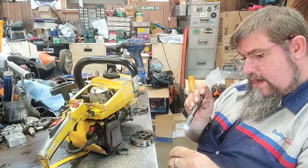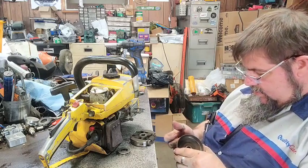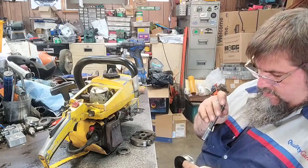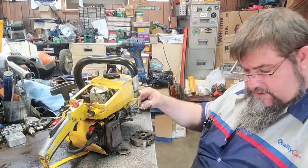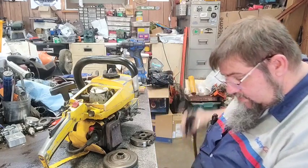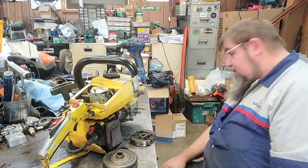This bearing is dry. And this clutch drum is worn. Oh, mercy. I'm going to see if the clutch drum is worn as bad as the bearing. It ain't the best in the world, I can tell you that right now. It's really got a lot of wear on it. The crank ain't in the best of shape either, so. Oh, come on now, don't you come out of there. The bearing's trying to get out of the hickey-doo and the doohickey.